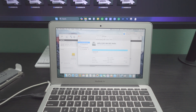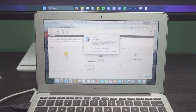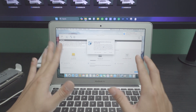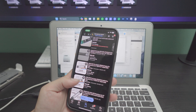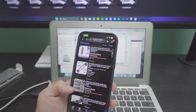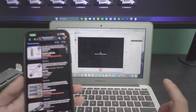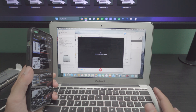Looks like we're not in the clear here. Let me see if Carbon Copy Cloner can detect this. It's reporting read or write errors on Macintosh HD — the problem is a media failure. This might have some mechanical failures on the solid-state drive. Of course there's always something wrong in these videos. You could easily replace the SSD, but I'm not sure I want to pay twenty dollars for an SSD and not use the computer.